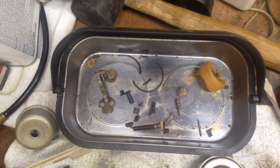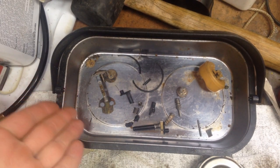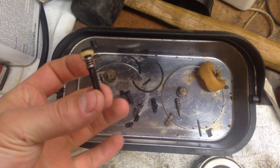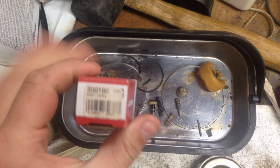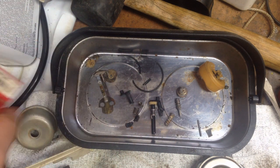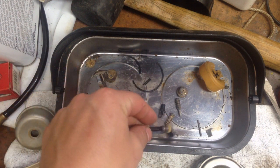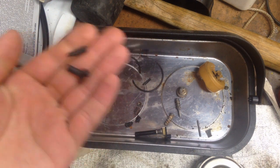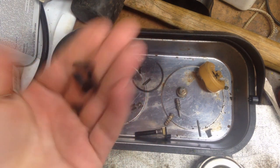We're back on the snapper mower, and what you see in front of you is what's left of the carburetor. I had to buy a new choke shaft, part number 398186, because when I cleaned this before I put it away, carburetor cleaner completely pretty much melted the old choke shaft. That's what's left of it anyway.